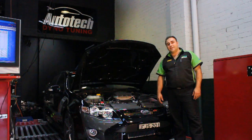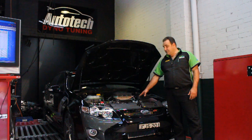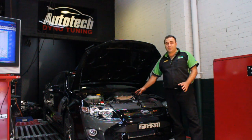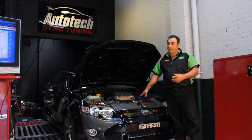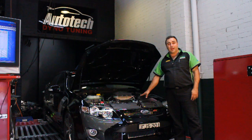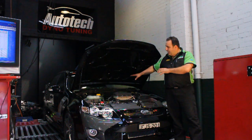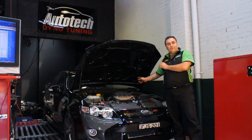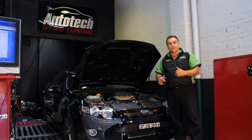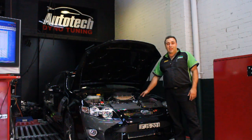Okay. So if you're the owner of a GT or a GS with a Coyote engine, come in and see us for the Herrod Stealth Intercooler kit. Just remembering, this car started initially with 320 kilowatts in standard form at the rear wheels and ended up with 435 as a finished product. The GS will achieve the exact same amount of power, as they both have the same engine, drivetrain, everything. It's just software configuration that allows the car to be detuned a bit more. So overall, whether it's a GS or GT, they'll both achieve the same power level.